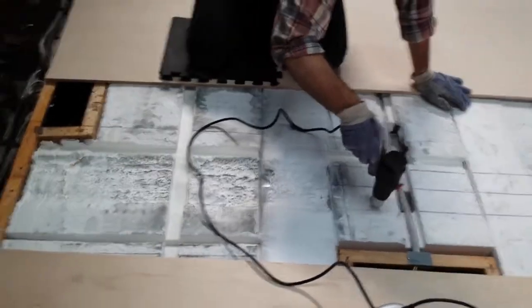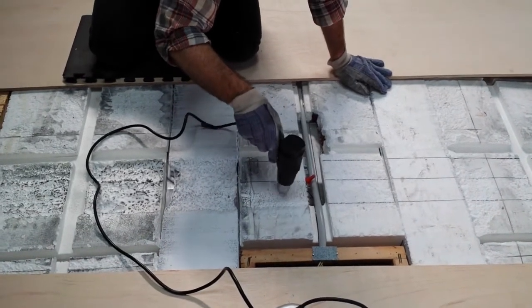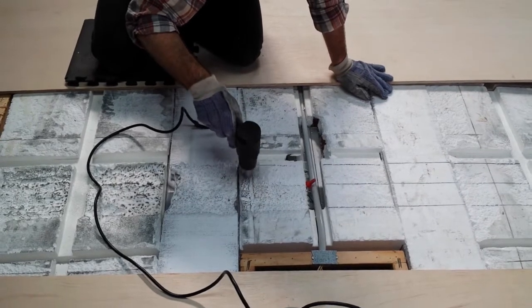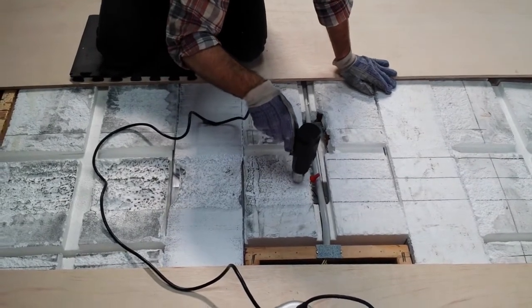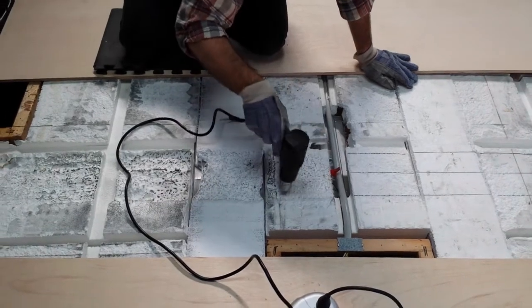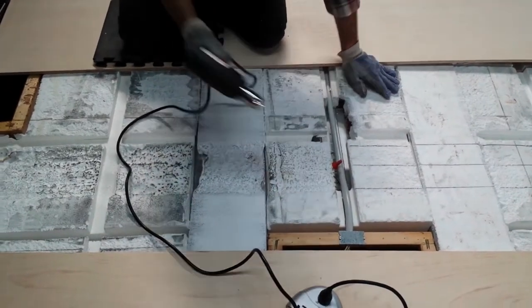And you can see me here with the heat gun. It took a little time, but it went quicker than I had anticipated. And of course, it's not an exact science. You don't get a nice straight edge channel for the 6-inch strip of plywood, but so what? I just had to make sure I melted it down as uniformly as possible so that the 6-inch strip of 3/8 plywood wouldn't stick up in one area or another.